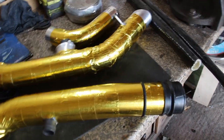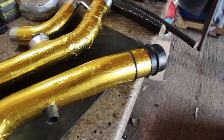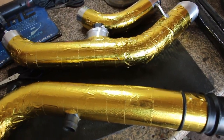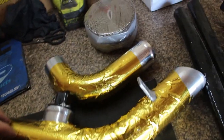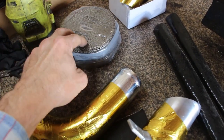This is basically intake. So this comes from the air filter, and then up to a bend which comes into here. This comes round, last elbow into the turbo. So again, nice cold intake we've got. Even if it's 1 or 2 degrees less with this on, I think that's worth it. Again, engine bay temperatures are going to get pretty warm, and a lot of this pipework runs behind a radiator. So the next thing to wrap up, to help with bay temperatures again, is exhaust.